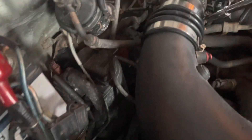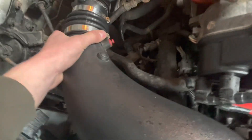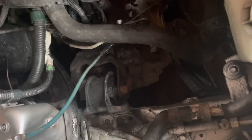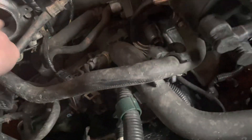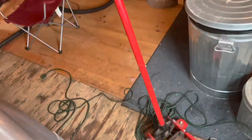I'm gonna take off the throttle body and check the throttle body gasket, since I have a suspicion I didn't check that and that could be the case. While I have the throttle body off, I'm gonna go ahead and take off the idle air control valve and put on the one that I know is good, which I have right here — just replaced this one. But I think this one has a bad TPS, so we're not gonna put it on.